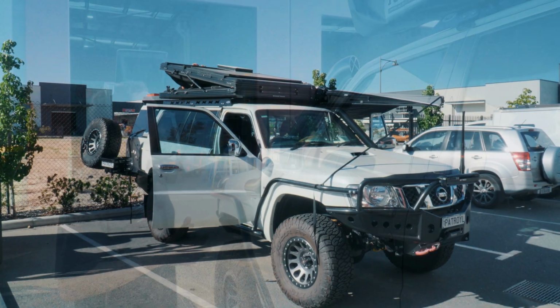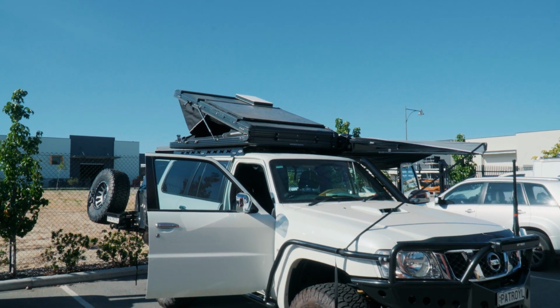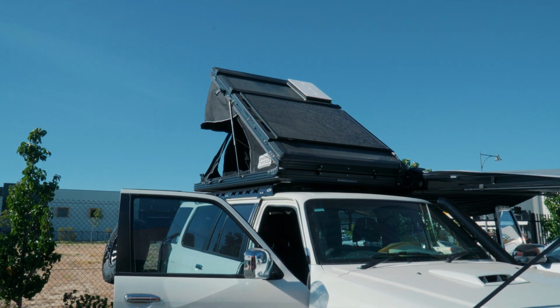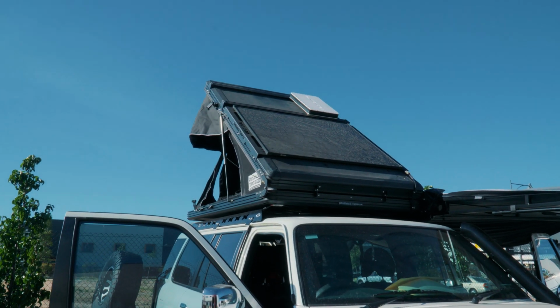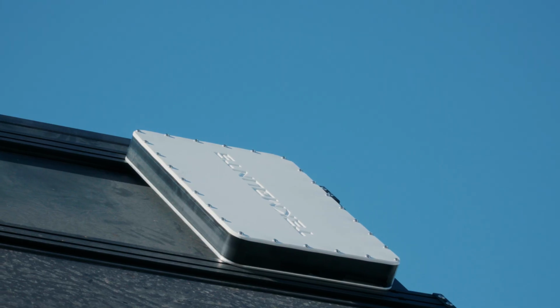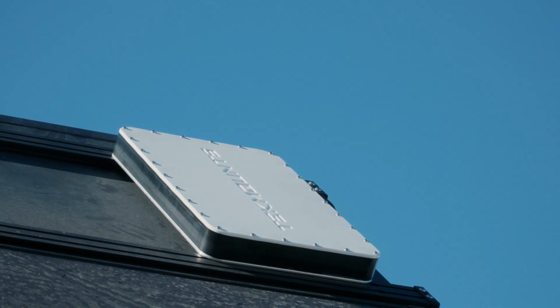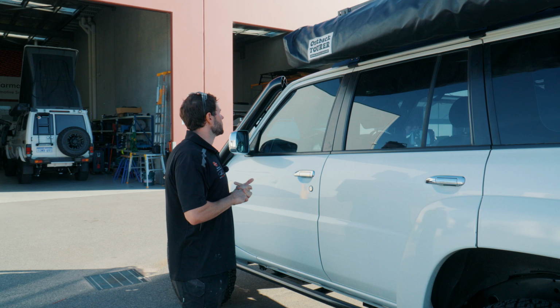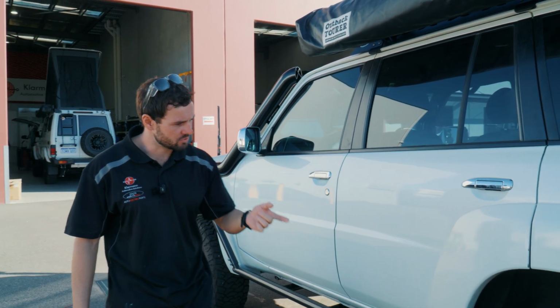On top of the tent, there's a solar panel. Same thing, we've run power to that from the MPPT, and that way he's got his solar power. And then on the back here, he's also got Starlink. That's the Gen 2 Starlink, so same thing, we've wired the power from that to the 48 volt converter, which is housed in the back section.